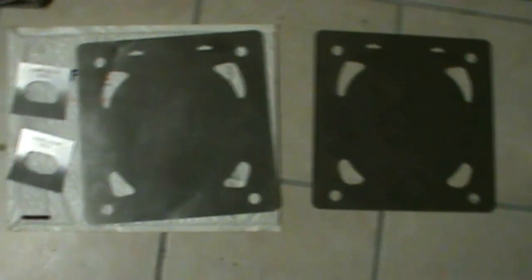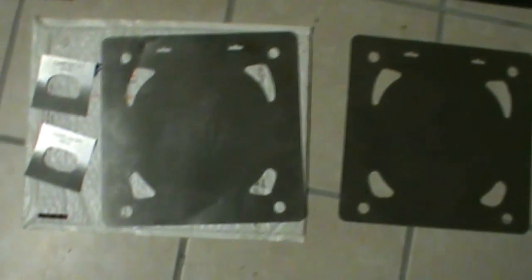Alright guys, to start off, these are my street port templates. I have two sets — one's the small street port and one's the medium street port. They're made by Pineapple Racing; you can see they have their logo laser etched in there. Starting off with the smaller ones, these are the primary intake ports and these are the secondary intake ports. It'll only run off the primary intake ports until a certain RPM percentage, and then the secondary intakes open up and it'll be running off all four ports.